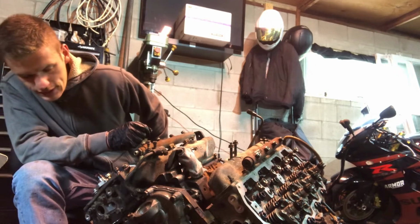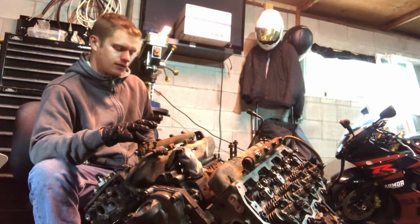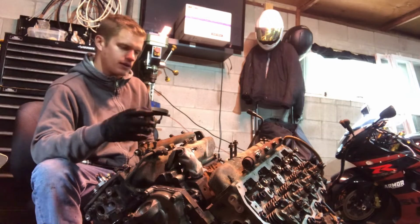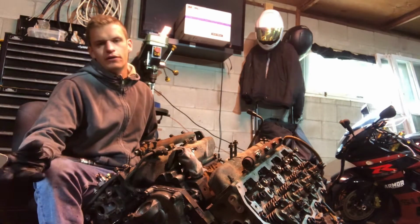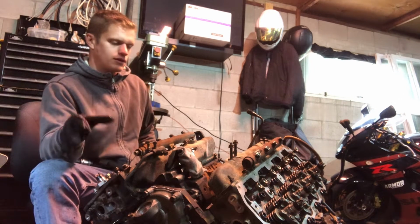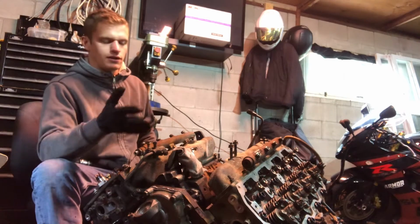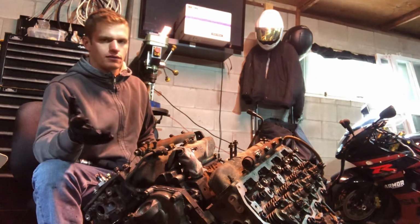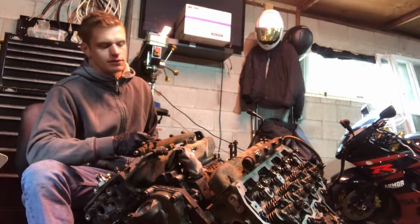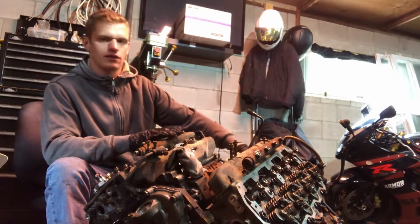And also the valve covers, they have a vent. Most old diesel engines on big trucks and stuff like that, there's a tube and it goes to the ground. Usually you see it puff out smoke, or it'll drip out smoke a little bit. These ones, most vehicles, they will go back into the air intake, and so you're sucking in hotter air and oil contaminated air. The best thing to do is have that dripping out the sides of your engine, especially on any Duramax engine. Even gas cars do have that as well.